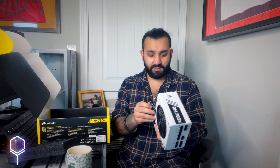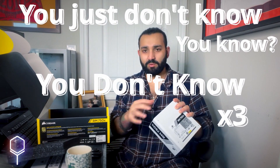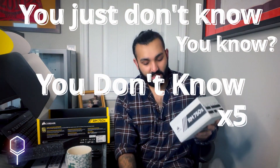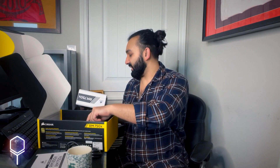I did buy this brand new. I've been trying to find used parts for the PC build, but the power supply unit is one thing I don't want to buy used — you just don't know what somebody's done with it, whether all the cables and connectors are there, how it's been run, or if it's been in a hot environment. The other option was Corsair's CF series with RGB lights in the fan, but all the RGB ones are rated bronze — I don't want that.